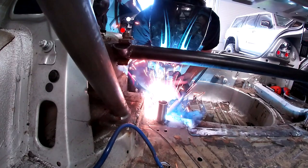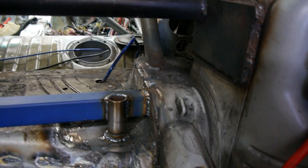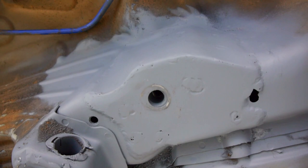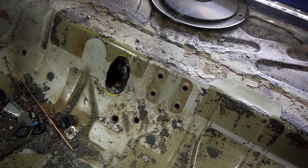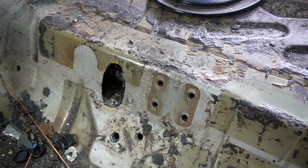These things aren't going anywhere now - that's all welded in there and looking pretty good. We do need to think about the front subframe mount points, so that's probably going to be the thing we're doing next. We're going to put the car up on the hoist first and make sure we properly locate those and drill in the right spot. Basically what we need to do is go up through the hole where the stud goes through for the subframe and put something through there like a punch that's going to hit hard enough that we can see from the top side where it comes through.